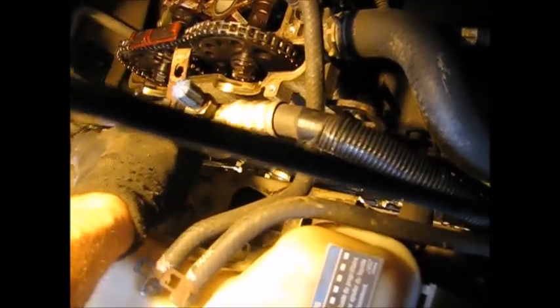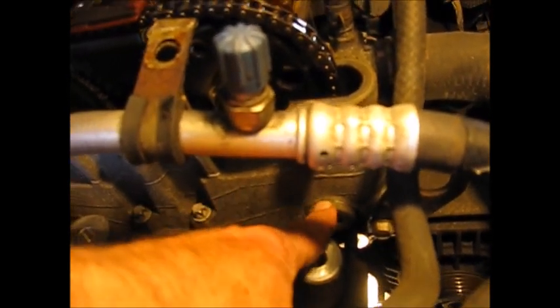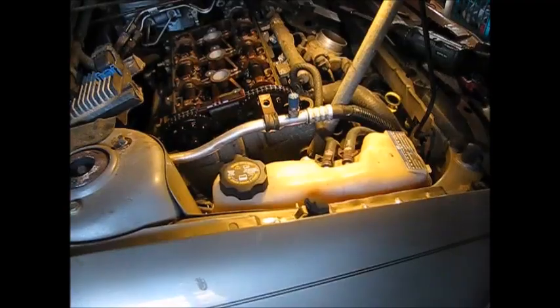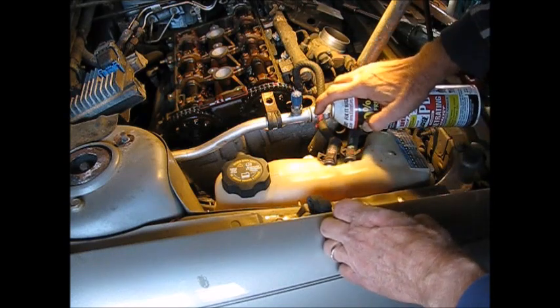The lowest one I have to do from underneath — I can't reach it. Here's the problem: these three bolts backed out all the way and they top out against the inner wheel well, so you can't get this piece of the front engine mount out. Therefore we can't get a tool in here to take this plug out and remove the fixed right-side chain guide. I shortened an Allen wrench — it's 10 millimeter in there — but the cheater bar won't help. Time to put in a little penetrant and let it sit for a while, try it later.